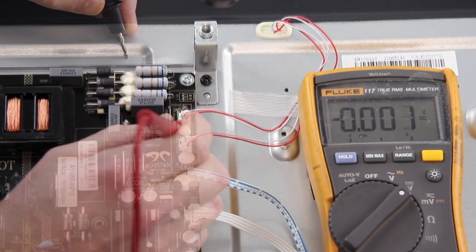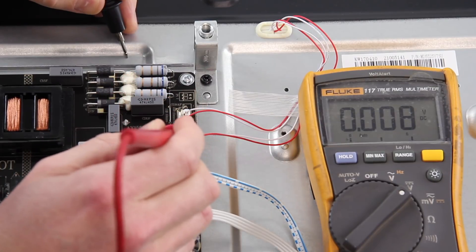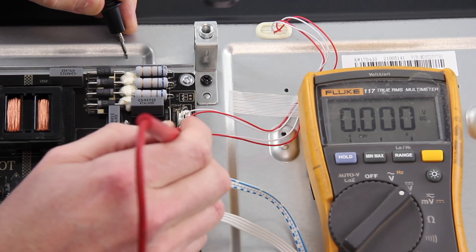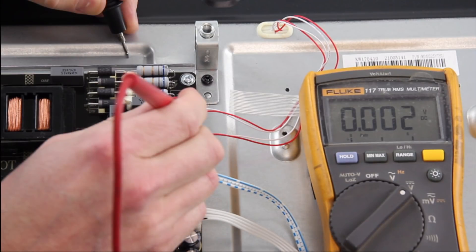If the voltages are at zero or less than what they should be, then the problem could be with the board or the LED strips. You can troubleshoot further by unplugging the TV, disconnecting the cables, then plugging the TV back in and checking for voltages on the board. Be aware that if voltages show as zero, the TV could be protecting itself — sometimes when there is no load on a connection, the TV will stop outputting voltages to the backlights to prevent damage. Testing voltages on the board can only work if you know what the voltages are supposed to be when they are good.